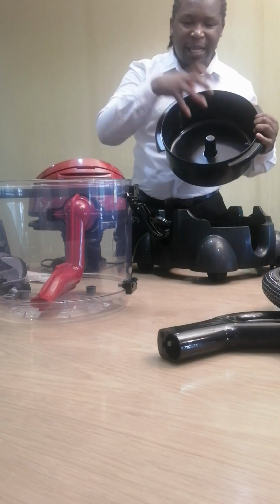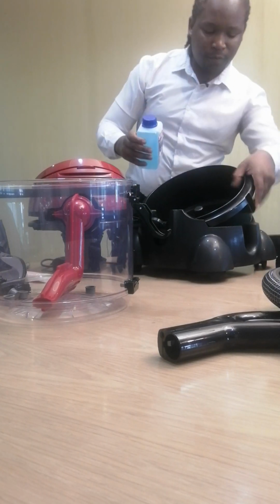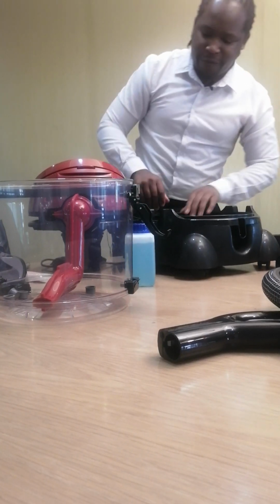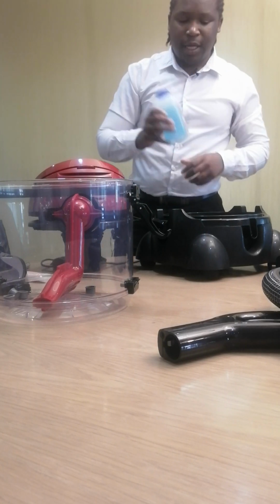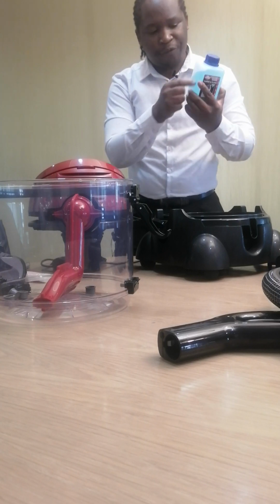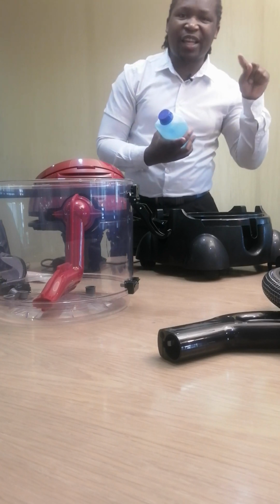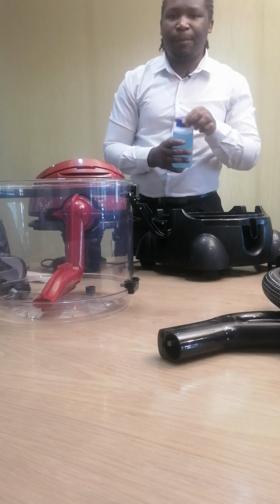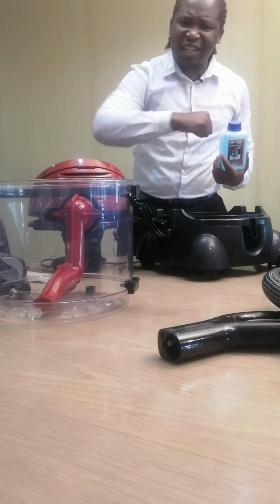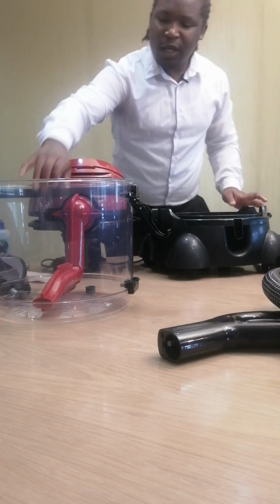This is where I put in clean water with the chemical. So clean water with this stuff here, I put it here. Remember, I know this machine already because I've done a video with Verimark on this. So clean water with the stuff. Remember, on this particular bottle, you'll put half of these detergents into a full water here. On the replacements, the one that you buy, they are 750 mils. You will put a quarter of a cap. These detergents are what we call low foaming chemicals, meaning they are strong in killing stains, but you're not going to see bubbles, you're not going to see foam. You're not going to see that like how we see it with the dishwashing as well. Okay, so we put this back.